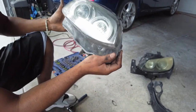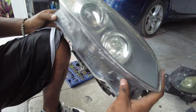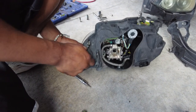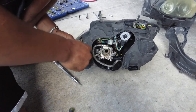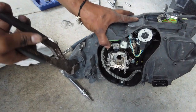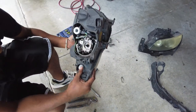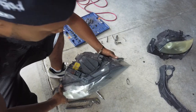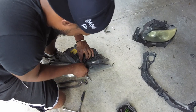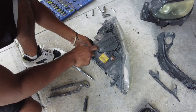There appears to be something screwed into the back of the lens — I'm thinking it might be this black overlay, so hopefully that comes out with it. There's also a little cap over here which is the turn signal bulb — it can be a little rough to get out, probably need pliers. Give it a good wiggle and there's the light bulb — you don't want to put that in the oven. Taking an overall inspection of the headlight, this rubber piece looks like it could easily burn so we're going to remove that as well. There's also a cap here with another bulb inside, so we'll pull that top cap off too.